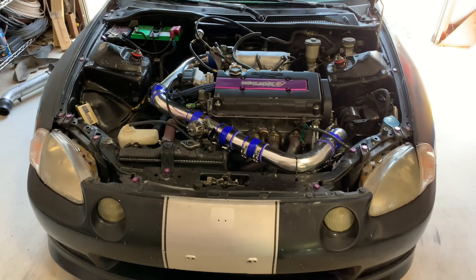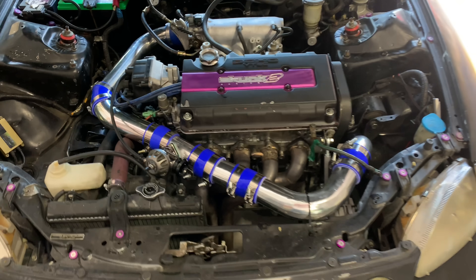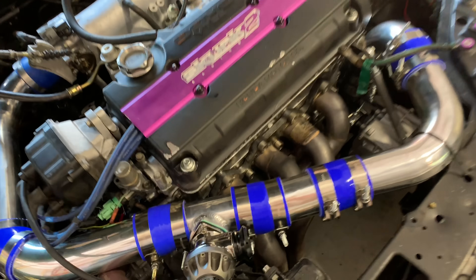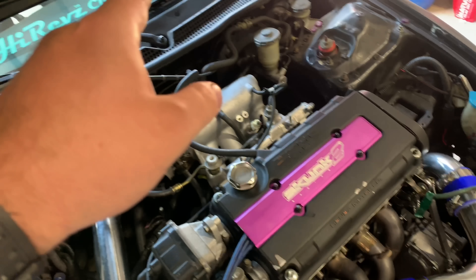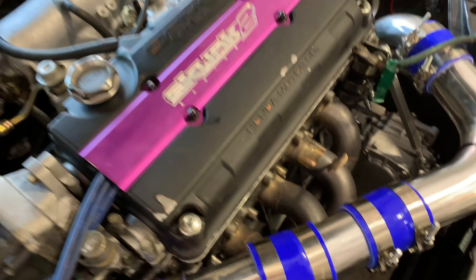The engine has warmed up and everybody's calmed down. Had a few boost leaks — that's what all the squealing was. So this blows out here all the time, and that supercharger is making boost all the time. When you go full throttle, it takes away your vacuum to your blow-off valve.